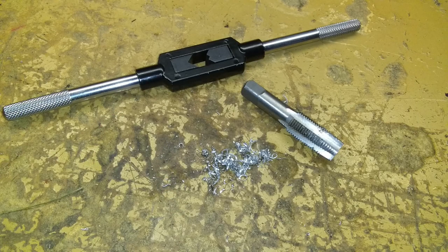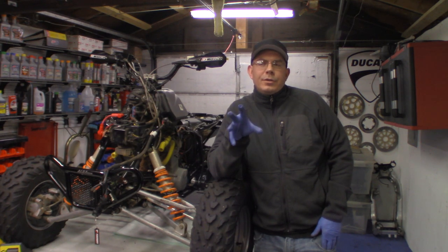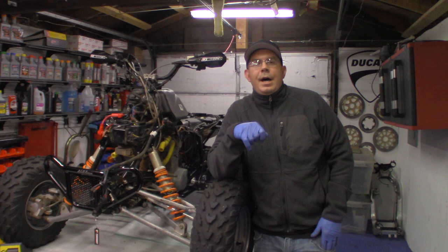If you buy one of these radiators for this Polaris Outlaw with the KTM 525, and you see the dual core radiators for sale on eBay, what they basically have is the thread for a Predator, and the Predator thermo switch is a 14 millimeter. So you need to tap the hole from a 14 to a 15, and then from a 15 to a 16. And the KTM sensor is a 16 millimeter by 1.5 thread pitch.